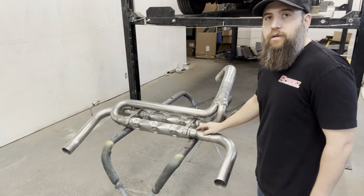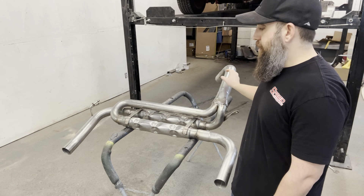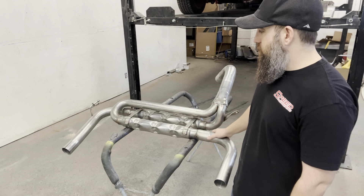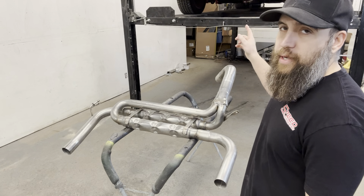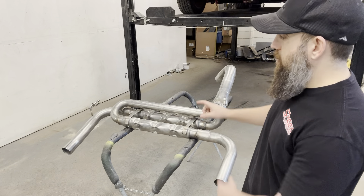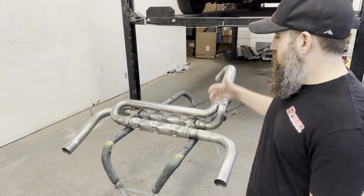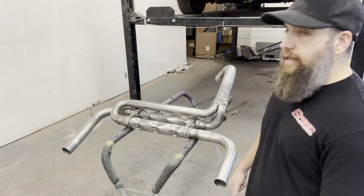This is where we get started — this is the GMMG 82-to-02 F-body catback system from Hawks, the chambered exhaust. It should sound really really killer. It's got Speed Engineering long-tube swap headers on it already. So basically what we're going to do is hang this at the back, get it on its mounts, put the intermediate pipe up there, and then fab a Y-pipe to come from the Speed Engineering headers through this catback.